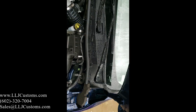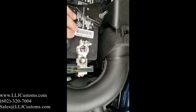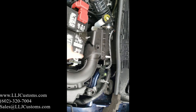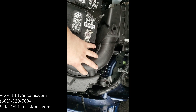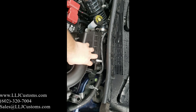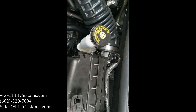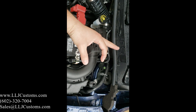Your battery is going to be on the driver's side of the vehicle. This is your air intake filter. To get the battery wire in, there's a wire harness right there. To get in there you'll need to remove the filter compartment. Take off the plastic intake — it's on there by pressure — clip it and it comes out. Undo one of the hose clamps, pull it out, then there are two Phillips screws and you'll want to undo the wire retention. Once those are removed you're good to go.